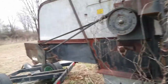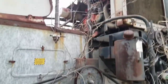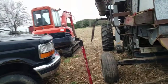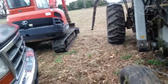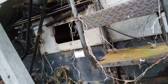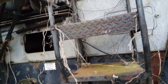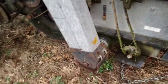But looking at it, nothing's rusted out. The bin's not even rusted out — I know it's galvanized, but on my M2 the bin was rotted out of the bottom. The engine does turn over; it doesn't turn over very fast. I used the excavator to get it off the dolly — just picked the dolly up and pulled it out from under it. I hooked a battery up to it with the F-350, just wanted to see if it would turn over with the starter, and it does, but it's really slow — either I'm not getting a good enough connection or the starter is weak.